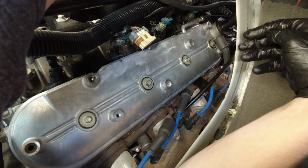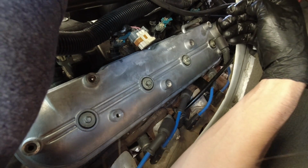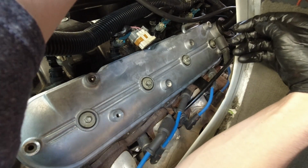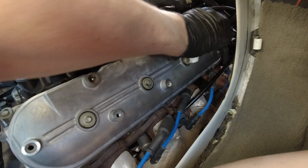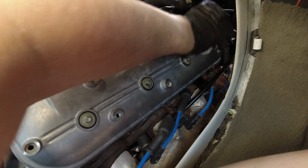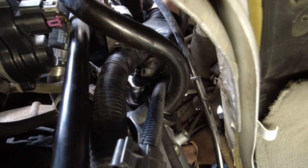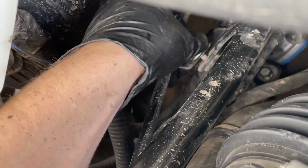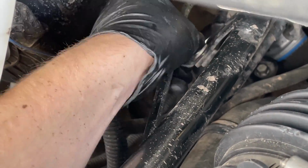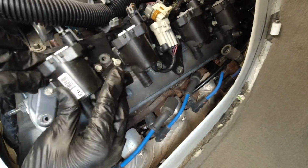Also, don't forget that hose that leads back up to the throttle body. And then once you have your 4 valve cover bolts torqued and the fill tube back in place, then it's time to re-secure that fill tube with that 13mm bolt. Then while you're under the hood, might as well re-secure your oil dipstick tube to the oil fill tube. That's that 10mm bolt. And back inside the van, you can pop your coils on next, the 5 10mm studs.